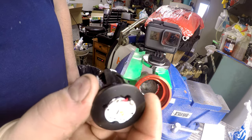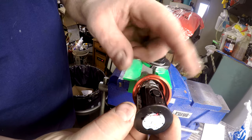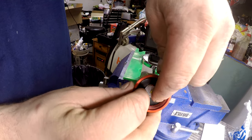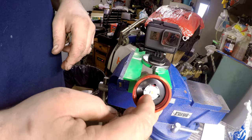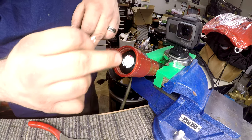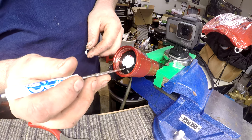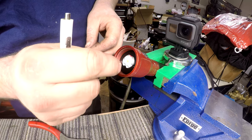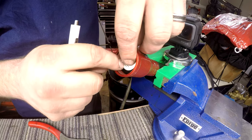Then you want to take your new LED bulb assembly and slide it down there with the actual switch facing towards that switch. Wiggle it in just like that, then press it and make sure the switch is actually lined up. Then take your white LED retainer — big gap goes towards the wire. You have two holes in the LED plus one hole down here. If it's off center, you can actually move that LED; it's not really glue. You can slide the board so all of this will line up and sit flush.